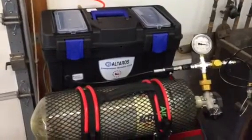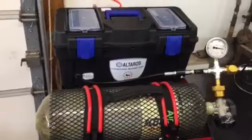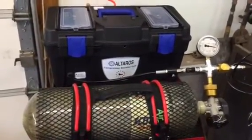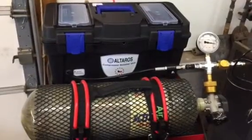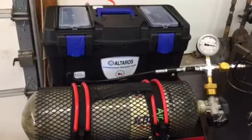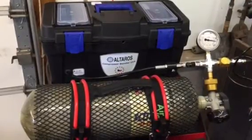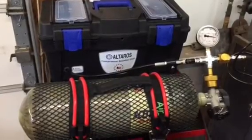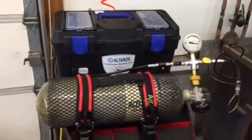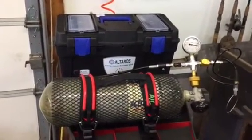I wanted to show how it works now and let you see the difference in speed. If you go back and look at that other video on my channel you can hear the difference — let you hear that. Basically all I did was tune the airflow screw that meters the air coming in.